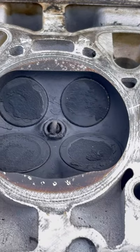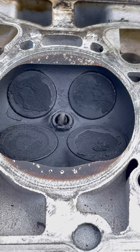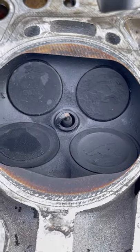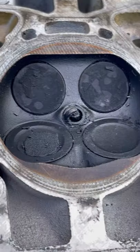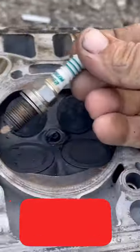Whatever's bouncing around in that cylinder can damage the cylinder walls, and it can also get caught in your valve seats and damage your valve seats. Now that material only happened in cylinder number two — it's not in any one of the other cylinders. So it's a good idea to go ahead and change your spark plugs.